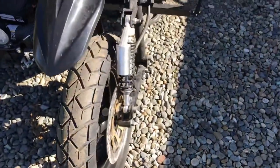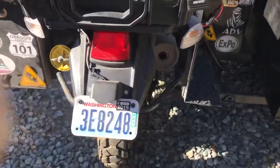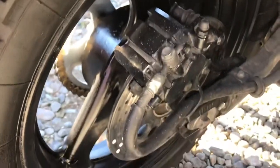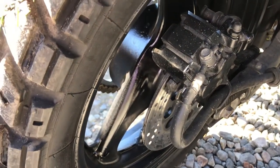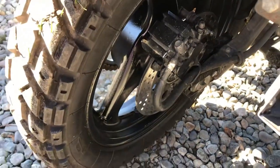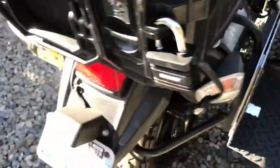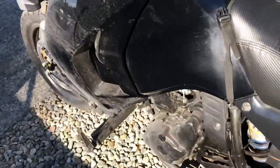My big news was I was able to fit these wheels on. This has got a 20mm bigger rear rotor than a stock KLR, so I had to make a bracket to relocate the rear caliper. You can't really see it, but it's in there — it relocated the caliper so now I can run a bigger rear rotor. Motor's all stock — everything's stock: stock exhaust, stock airbox, stock jetting. I'll get to that one of these days.